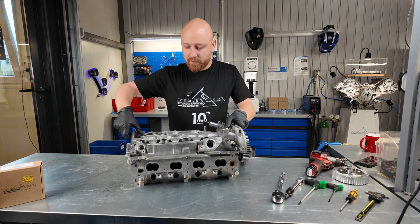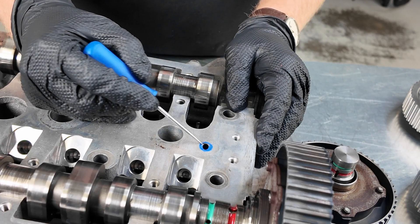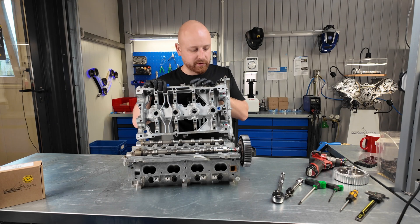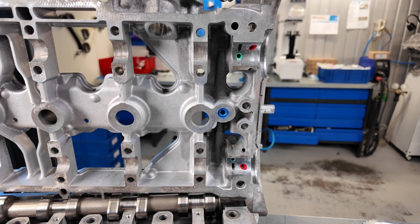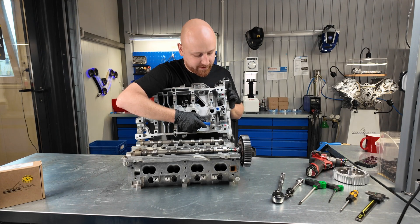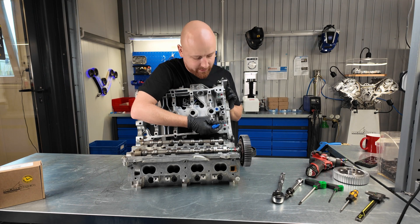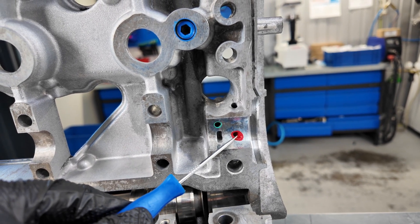Now let's take a look at the valve cover. The oil from the oil pump is carefully directed through specific openings in the cylinder head and here in the valve cover, where it flows into the control solenoid valves for precise and efficient operation. From there, it's distributed to individual sections. The oil from these sections, directly from the solenoid valves, flows next to the first bridge, which is positioned closest to the timing phaser, ensuring smooth lubrication and optimal engine operation. Here we have the exhaust camshaft bridge, and here we have the intake camshaft bridge. The corresponding holes for each section clearly indicate the flow paths. Here we have the engagement section, and over here we have the disengagement section.